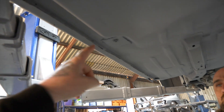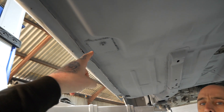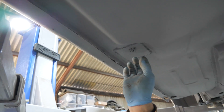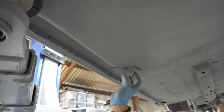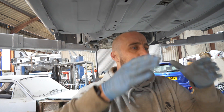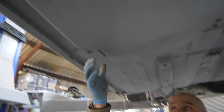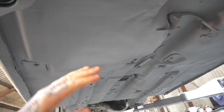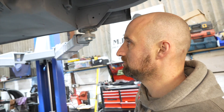This seems to be something I've seen on a lot of these Escorts - it's a failure point in theory, in the car. It's very odd. It's only one mil thick, the floor pan. It's got a factory, but because these have been repaired before and they only had a small plate on them, normally you'll get like a half-curled-up plate - so around the edges are all curled to make it stronger. But yeah, we've just gone for a three mil plate. We're going to seam seal around that when we do the seam sealing. Other than that, it's literally tidying up stuff that you've already done. You're at the point now going forward where you're pretty happy from here that way forward.